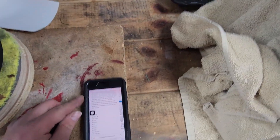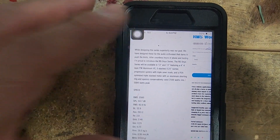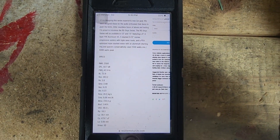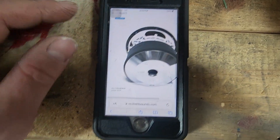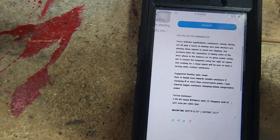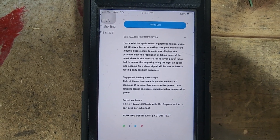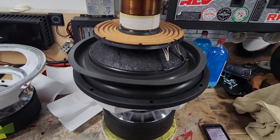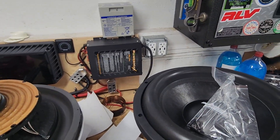I'm going to put this up for a second — you can pause the video if you wish. This is straight off of Resilient Sounds' page, including the X-max which is 30 millimeters. And if you scroll down there's a box spec — here we go, off to the side. So a healthy box spec is what Resilient Sounds recommends for these. From my personal experience, the Onyxes aren't too picky on boxes — they do very well in a good variety of boxes. But proper box setup is 100% key.